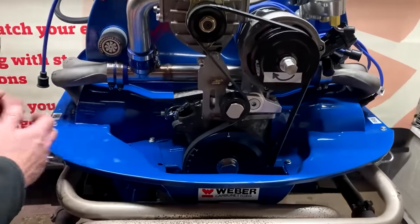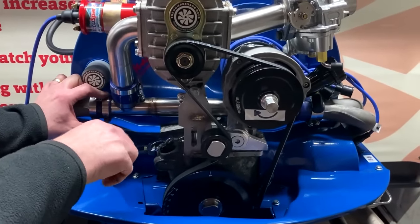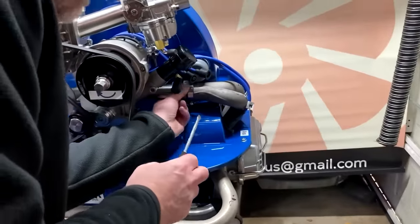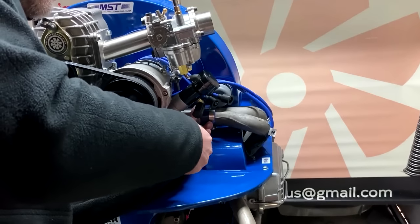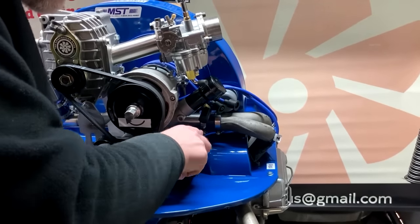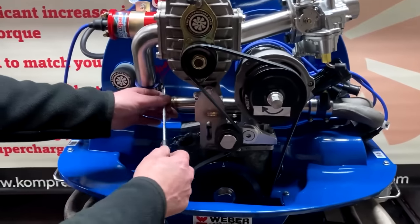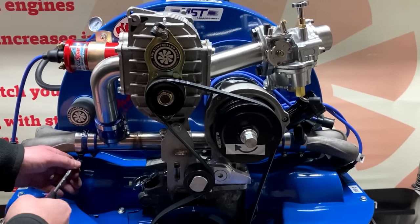Okay, now you can tighten the T-tube up by tightening your other hose clamps. So you've got one this side of the engine and one on the other. Another one. Two. And just check all your clamps, make sure that they're all fully tightened at this stage.